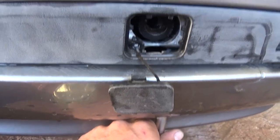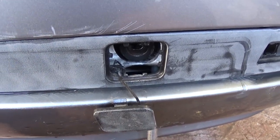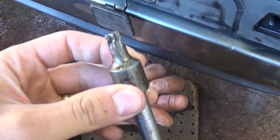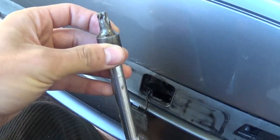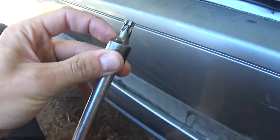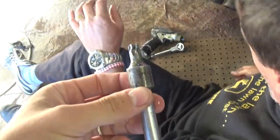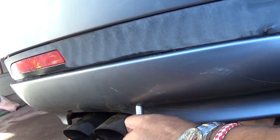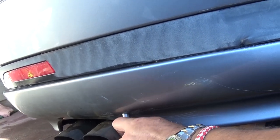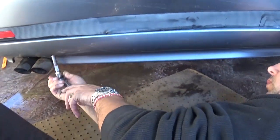You can see it's coming off — you can see the head of the bolt spinning. We have one more like that. It came loose, just like that. That's the socket we're using — you can see it's a T-50, it's a bit twisted but it still works. We have an extension too. Some models might have a smaller hole so you might need a narrower socket or a long screwdriver T-50, which is not very easy to find. You can take it off, put the extension, and redo the socket from the inside. There is another bolt like that on the other side as well.